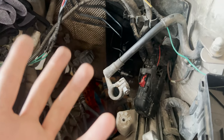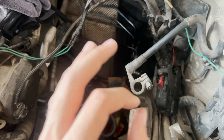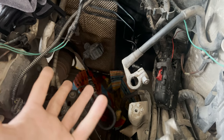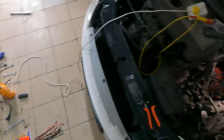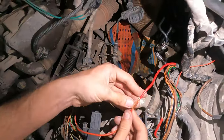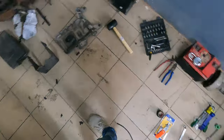It's going to be a little time consuming and we need to make sure that we do it correctly, because it's really essential that the ABS is wired correctly — otherwise the moment we give it power it can malfunction and stop working entirely, which will be expensive. It took me a couple of hours to solder them all properly, adding heat shrink to all of them. One of the wires needed to be run to the fuse box located in the engine bay as additional power specifically for the ESP. This was the only extra wire that was needed; the rest were reconnected from the original harness of the vehicle.